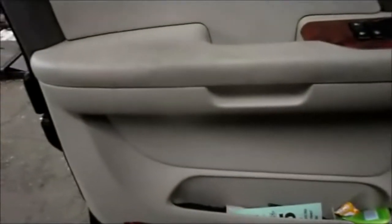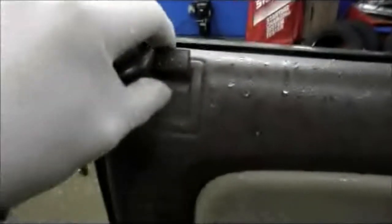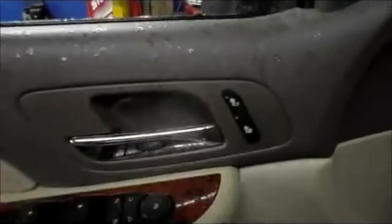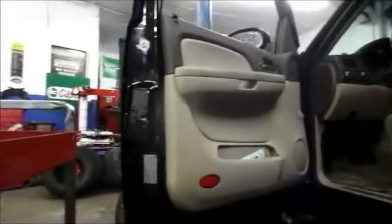We're going to take this door panel off right here. Roll the window back up — make sure you don't lock your keys in the vehicle; take them out and put them back in your pocket. We're going to take this door lock off. The way you do that is you get in here with a very small screwdriver, pry this open right here, and take it off. We're going to remove this cover right here, go inside with the small screwdriver again, pop this off, and take out the screw inside. Sorry about that noise — the heat is running today, it'll shut off in a couple of minutes.